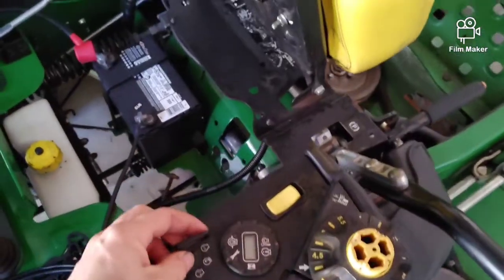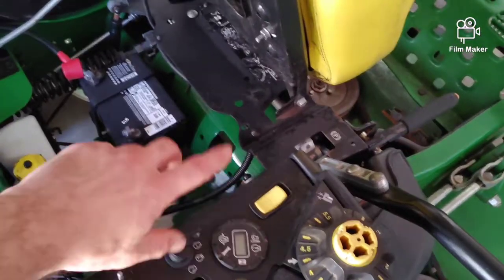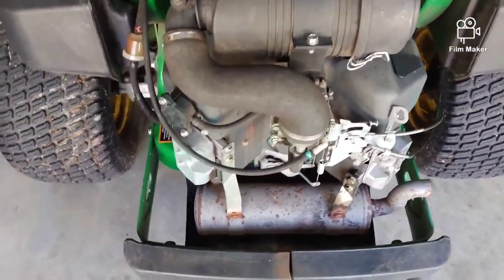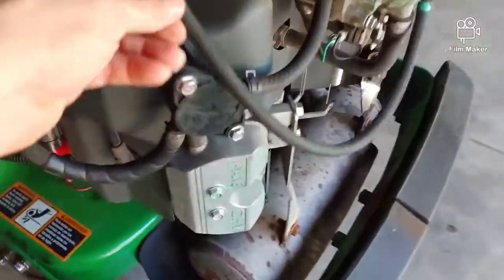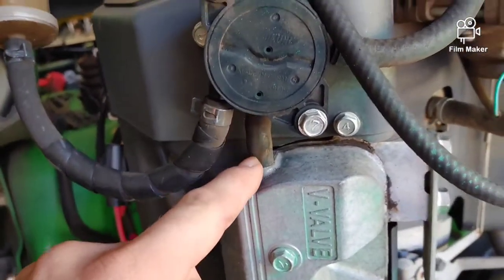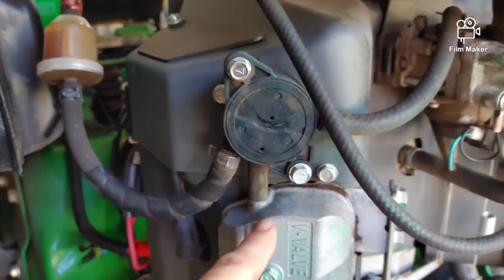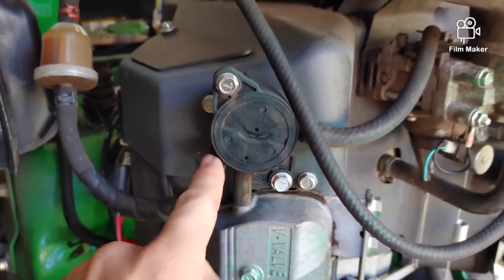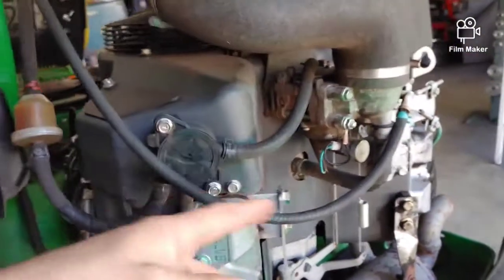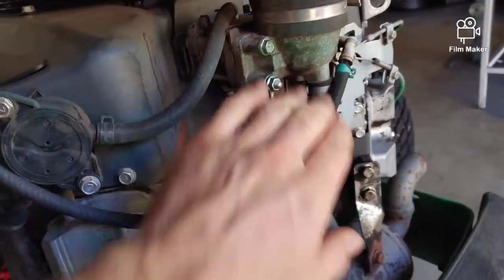Let's say the e-brake is up, everything's fine, battery's good, we're turning and the engine is turning but it's still not starting. There are a couple of things that could be. One — not very common but still occasionally happens — the fuel pump would not be working. If this hose here has a crack in it or is broken off, it's not going to pump fuel. It takes a vacuum from the engine to operate the pump. Take this fuel line off, turn the motor over, and if it's shooting gas out, we know it's getting gas — so it could be a carburetor issue.